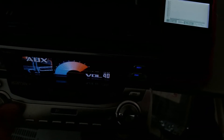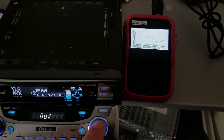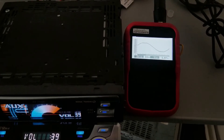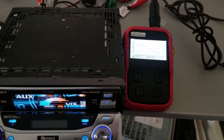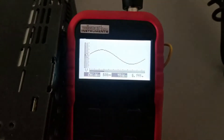With my phone all the way up, let's see if I drop my phone down and raise my head unit volume all the way to 40 — I have 4.97 volts. Going into source level adjustment and raising that up one click puts me at 6.14 volts. Pushing further I get 7.09 volts — dropping the volume one click brings it to 6.82, which looks like a soft clip. Dropping down again gives 6.14, so it wants to stay between 6.14 and 6.82 volts.